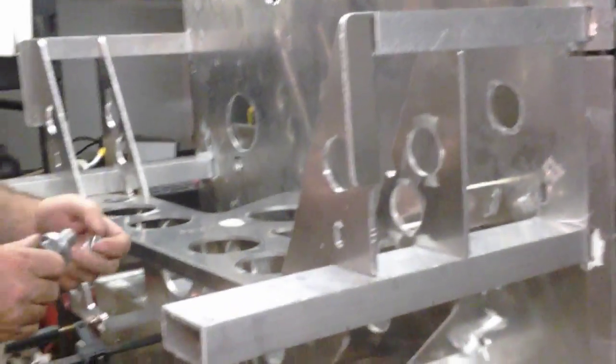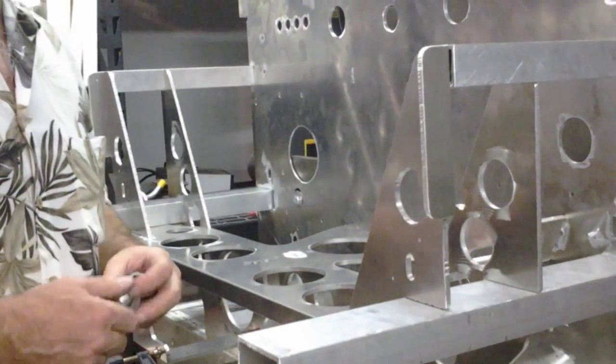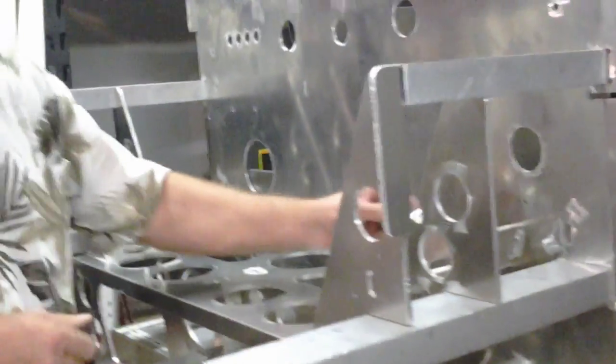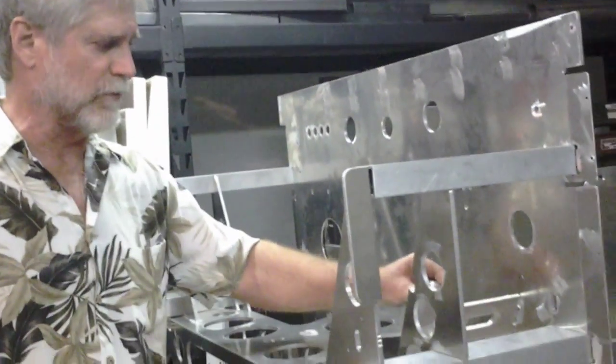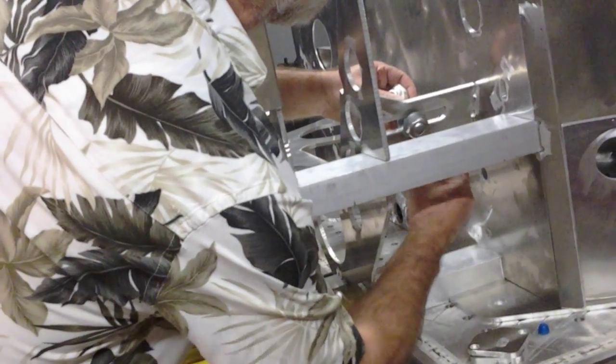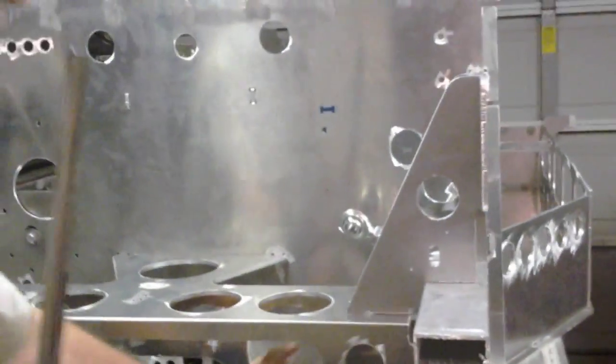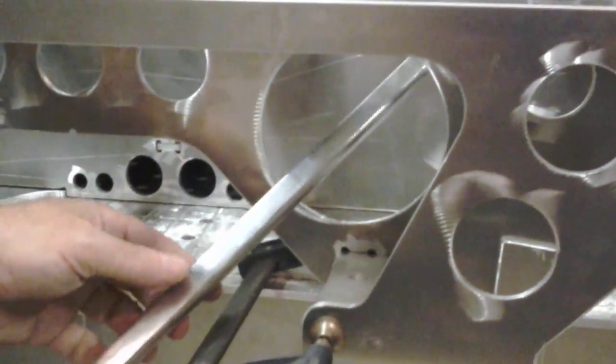This piece right here - I was happy that the geometry worked because it's at a funny angle. We talked earlier about the rod end and how if it's a double-knuckled U-joint on the steering, you have to support it in the middle. This is that oversize three-quarter inch rod end we talked about. Goes in like so. This is the double-D steering shaft - it's a 36-inch piece, we'll cut it to fit. This big hole right here - the double D goes through it.